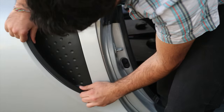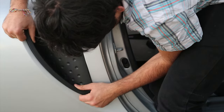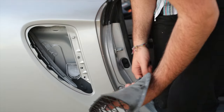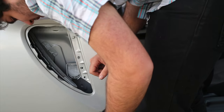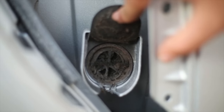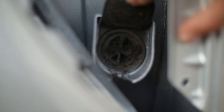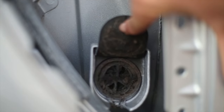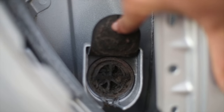That's the right side panel out. There goes some of my little white clips — let's see if we can get those back. At least I saved two of them. Here is the drain I was telling you about. It has a little flap to make sure nothing gets back up there, like exhaust fumes — you really don't want those getting in. If you lift it up, that is disgusting. So we're going to get the shop vac and stick it up to that drain, then get our little pick tool made from a wire hanger and pull out more. Then we'll flush the drain with water from the inside compartment.